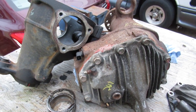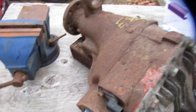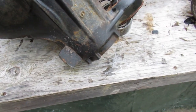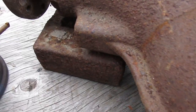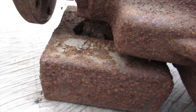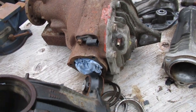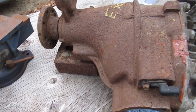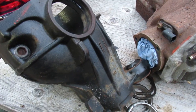So these are the two options for Jeep WK front differentials. This is essentially a 2009 differential - this nub here is not drilled. Whereas on this other one, it's got like a four-pound cast iron block sitting on it to deal with vibrations while driving down the road, but they only did that for the first couple of years and then stopped. If you find a part that's got writing on it like that, it means it came from a wrecker - that's pretty common.